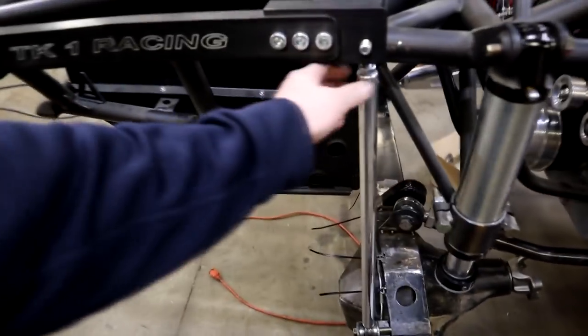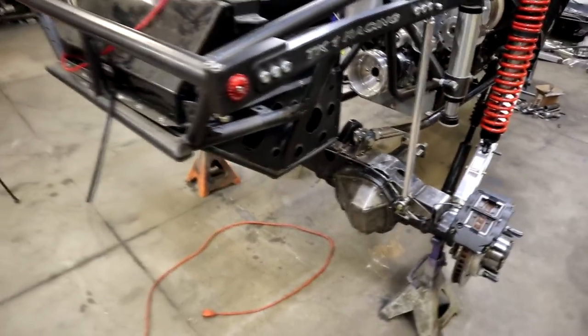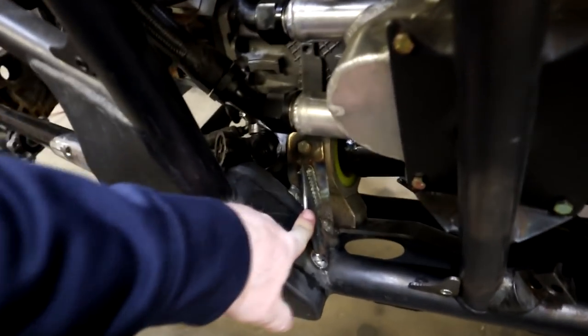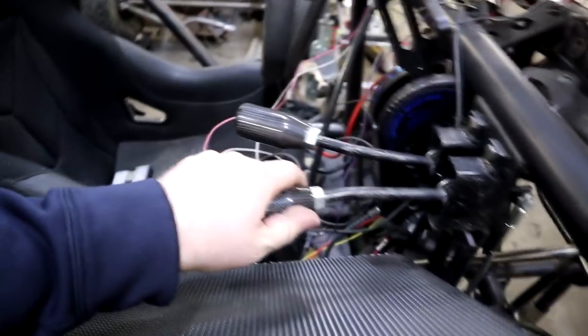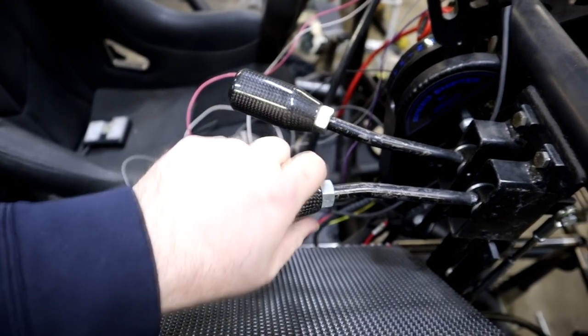The sway bar is set up as you can see here, with our links from Innovative Machine Solutions. We have the tabs tacked on, just need to finish a couple gussets and that's finished. We've been very busy. We also took care of a ton of stuff inside — created a carrier bearing setup with bracing, the tranny mount, t-case mount, all that stuff is finished. I got the shifters hooked up, even got these cool carbon fiber shift knobs on it.